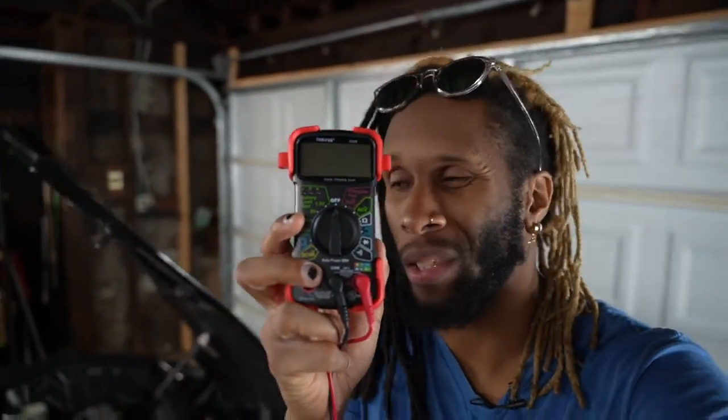The next step was to get a voltmeter to read the battery. I went to AutoZone and bought their cheap one — around 30 dollars. I hooked it up and read the battery voltage using the 12-volt setting. I checked it in the morning and later that night to see the drop while it was just sitting. I also confirmed that when I started the car, the alternator was charging the battery — it jumped from around 12 or 12.5 volts up to about 14-point-something. So the battery was charging fine, but once the car sat, the voltage would drop to a low 12 and keep dropping.